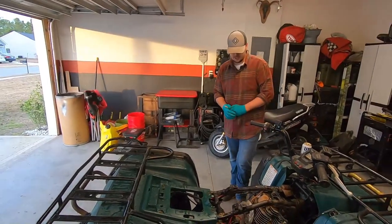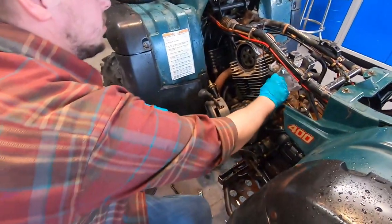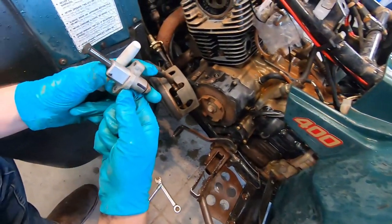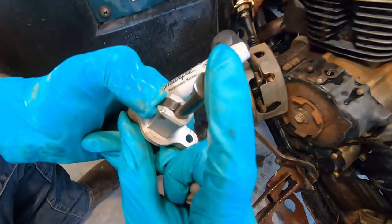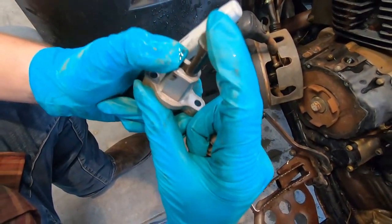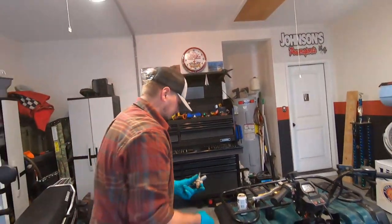All right, we're ready to pull the tensioner out. I'm not familiar with this engine, whether or not it's directional, so I'm just going to put a mark on it so we know that's outside. Loosen these bolts up. So this is automatic adjusting. Some people move to manual adjustments, but you can hit this lock here, and it's fully extended. So that means that the cam chain needs to be replaced? I didn't hear it making any noise, but if it's loose, you might as well let them know. Yeah. That's a whole new video, cam chain replacement. It is. Flywheel's gotta come off. Feed a cam chain down through there. But let's get this on the bench.